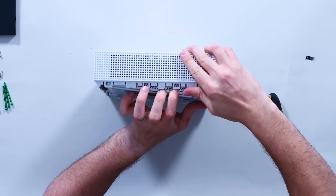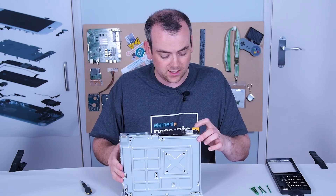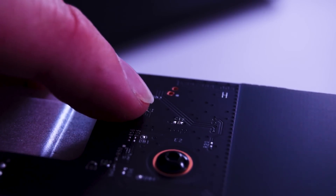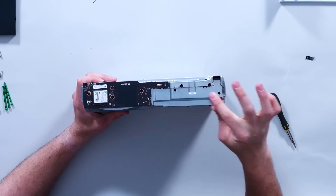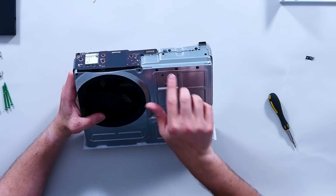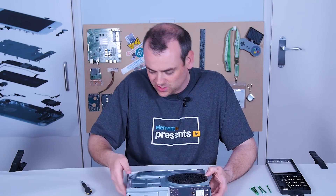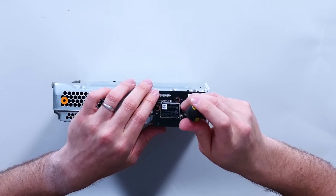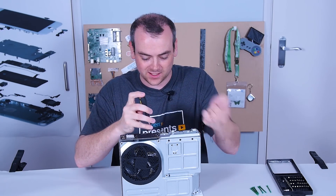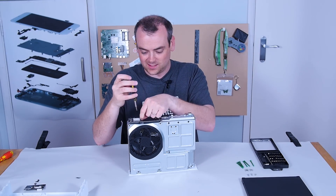Don't want to damage any of the components that are outside the RF shield. The top half is out. On the outside, on the front, you've got the wireless controller, the power switch — which is, again, a tact switch — and the connect switch, which are all tacked on. But there's still an eject button on the hardware. You can still see that eject ready for where the disc would be, and this pressing on the front, where the disc drive would be protruding from the RF shield, is a completely distinct piece of metal. They've not made a new press for this — they've just added a new one, and it's rough. The corners and edges in the finish are not consistent with the quality on the rest of the pressings. They've gone to market quickly with this.